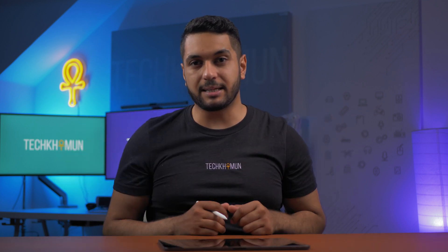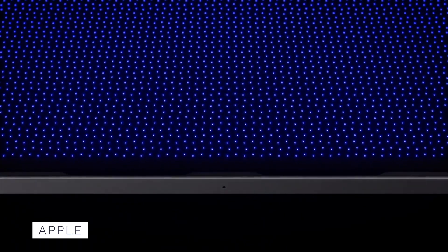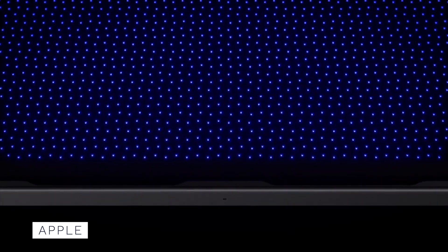So what is the blooming effect? Well, with mini LED displays it works slightly differently to OLED and LCD — it's actually closer to LCD than it is to OLED. The way it works is that it's got the same RGB color pixel layer on the top, and then it's got a whole bunch of LEDs — actually 10,000 LEDs — with over 2,500 local dimming zones.